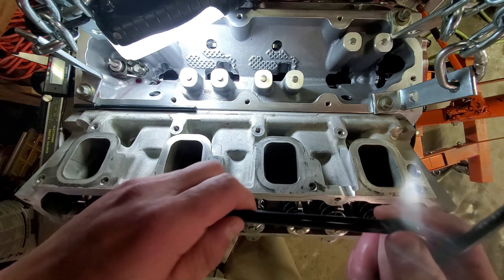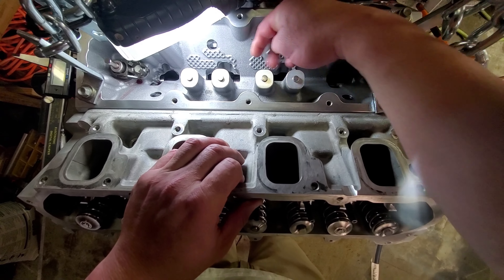I've already taken the liberty of measuring all cylinders, but I'll show you on the Comp Cams push rod length checker tool. It has a set of lines, and one rotation equals 0.050 inches, so two rotations would be 7.9 — it's not rocket science. When I'm done I use a digital caliper to confirm exact length. I had a couple turns out already — I know this is a hair short — so I'll seat it down in the lifter and spin to confirm it's seated.